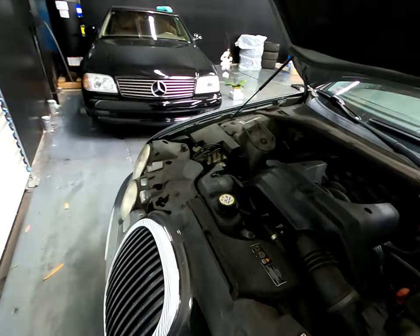So again, back to what to look for on these cars. So here, the expansion tank crack. I've had them crack here along the seam, but I've also had them crack down the side. I attribute it to the type of coolant that they use. It should be a pink, and we'll do a startup and exhaust sound on it. And then after we're done detailing it, when I go to take pictures again, because I'm retaking pictures and redoing all of my advertising, we will do the drive review and the feel and my rant on why I like the V8 S-types, not the six cylinders.